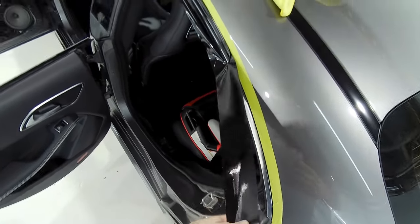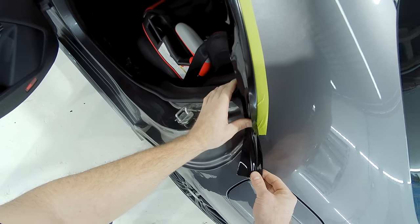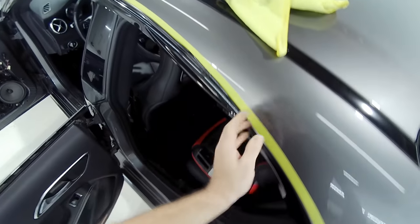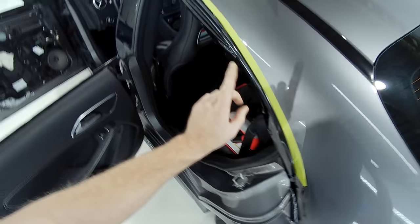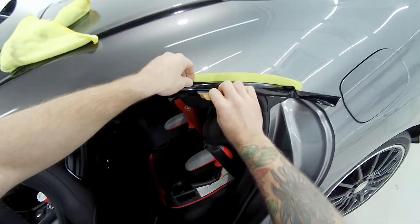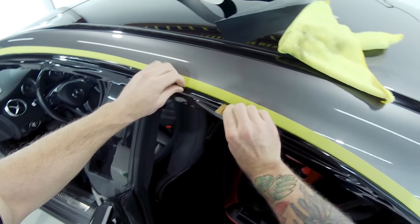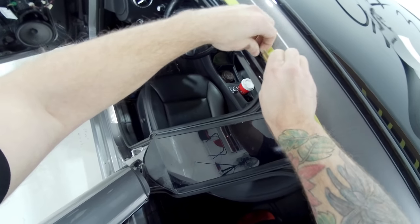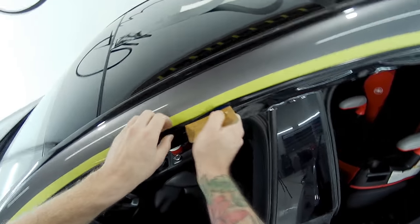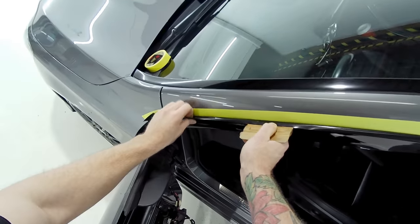Your pieces are going to be a little bit longer than what you need — it's better to have extra film than too little. You can't add to the vinyl but you can take away. The next step is to pre-tuck the film, which is very important. I can use the buffer side of my squeegee to get up and over that edge just enough. We don't have to tuck around a lot — it's all about getting coverage and not leaving too much vinyl. If you leave too much vinyl around the other side it's going to look sloppy and messy, and it won't have anything to stick to.